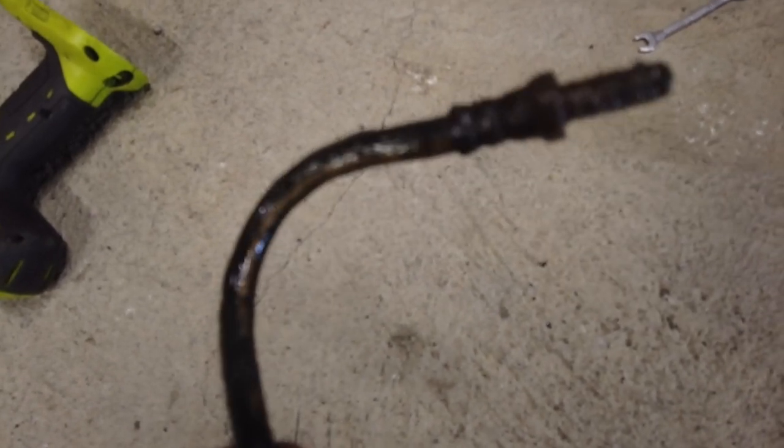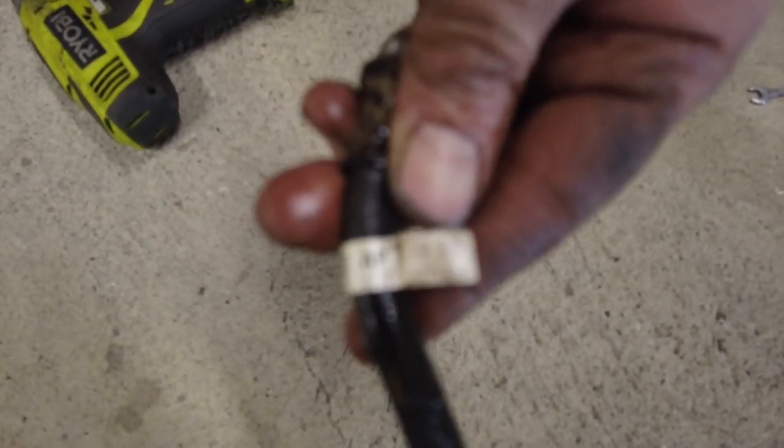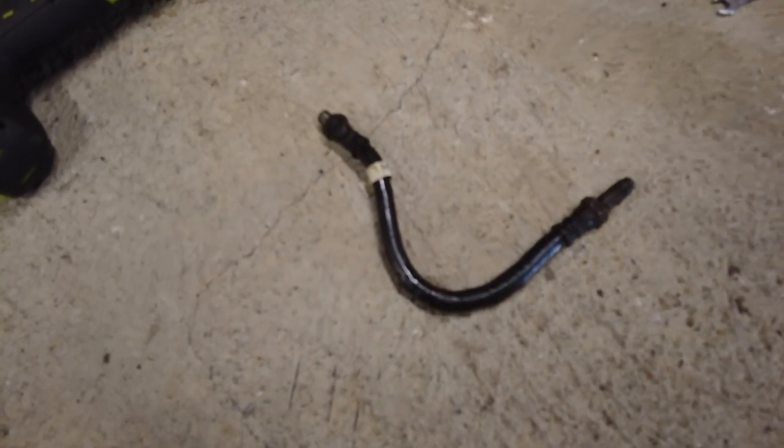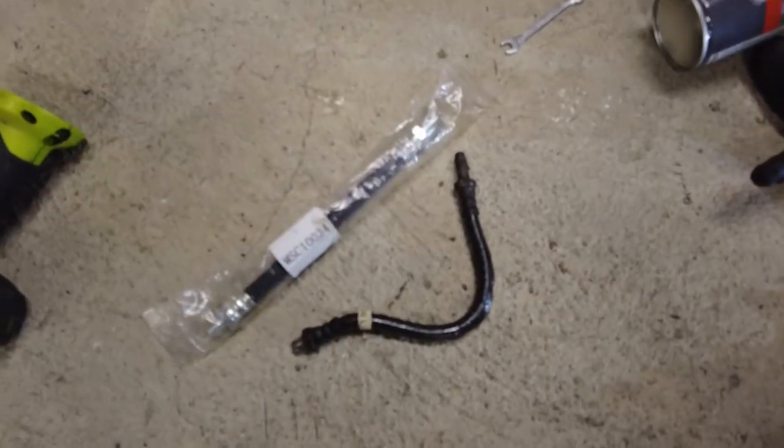Wait until you see the state of the rear brake line. That is blistered, it's damp, and it is generally in a very, very bad state - that's got to go. Let's see how much luck we have cracking off that union up there. You have to ask yourself how they get that bad. There's actually a date on it - 0979. So this car was built in 1979, and at the very least that brake hose was made in 1979.